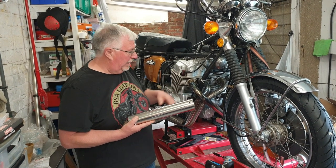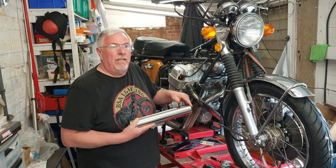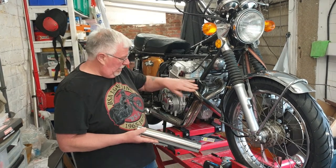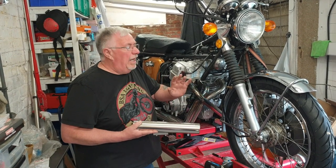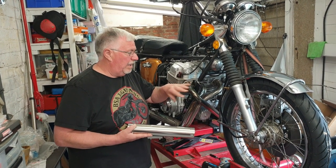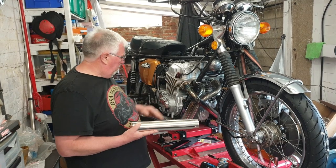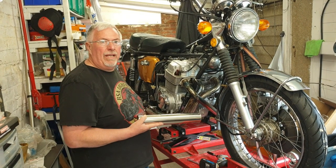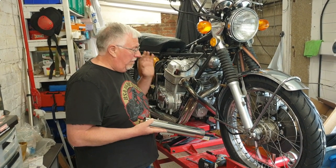You might remember when I first got this bike it had two pipes that looked a bit like a wood-burning stove pipe going through the ceiling, and part of one side was missing. So that came off virtually straight away. I put on shorty pipes on both sides, just while I was getting the bike going. This came off really easily. The original K0 exhaust is quite a nice sounding exhaust, but there are a number of issues with it - one is it's so short that it doesn't look like you've got an exhaust, and secondly because it's short there isn't a bracket that stops the center stand banging against the chain.